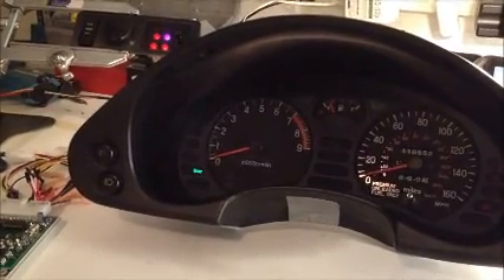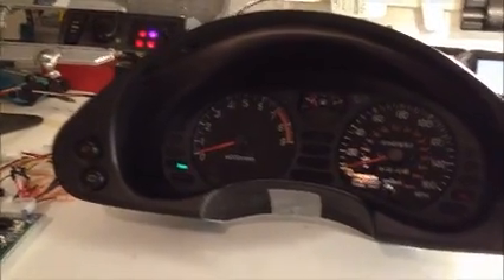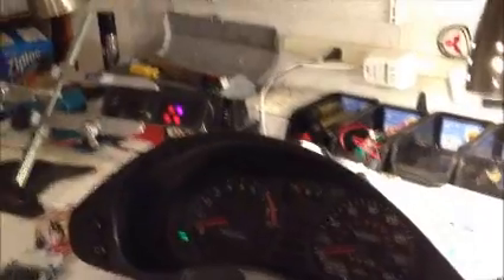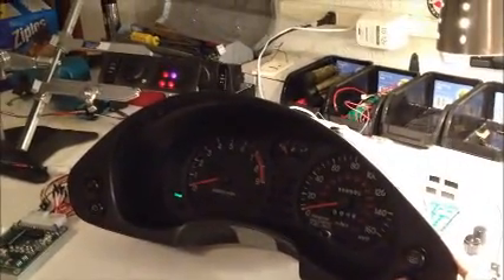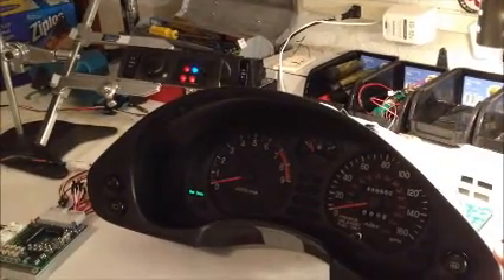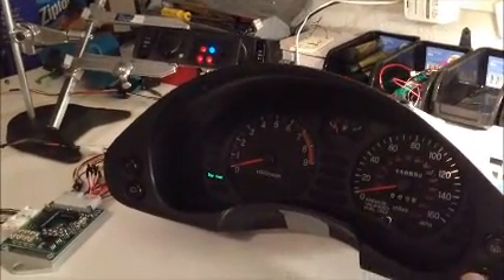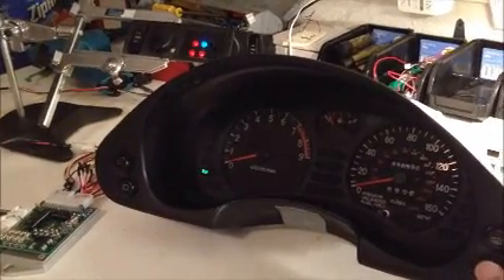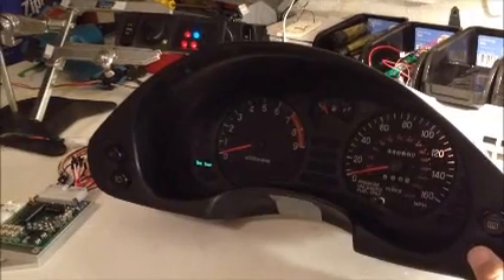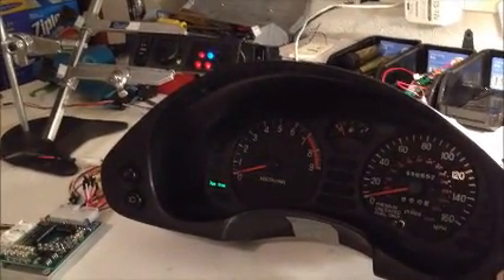I'd be interested in your feedback on that — whether it should happen more often or less often. So let's press the ECS switch and take the struts into medium mode. Now that turquoise color appeared on the LEDs for the front right strut, and you'll see that both the sport and tour lights are on, indicating medium mode. You're still getting the blink because it's still not able to get the other struts into medium mode, because there aren't any.